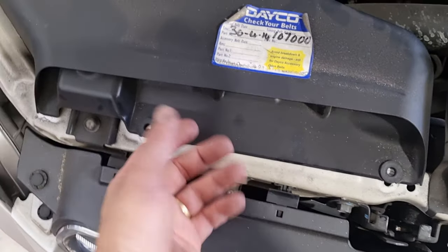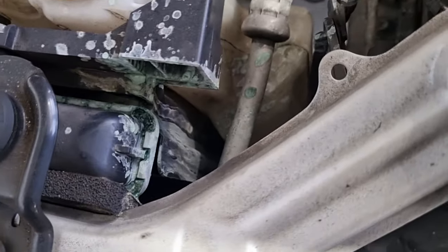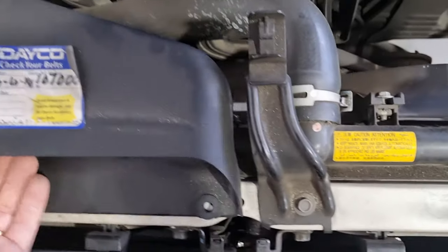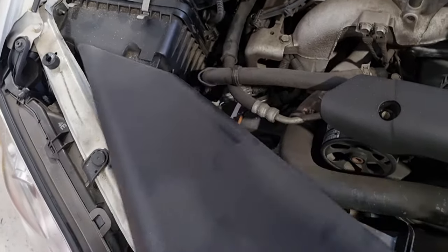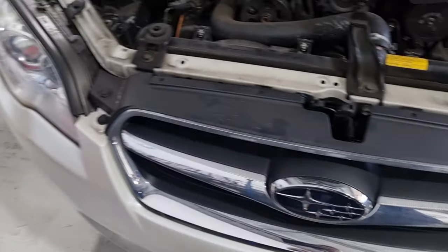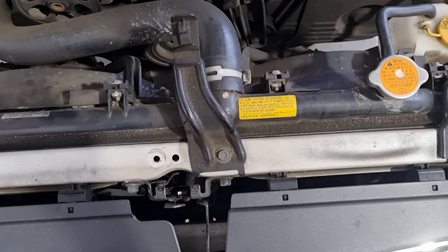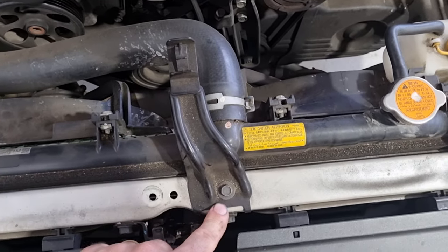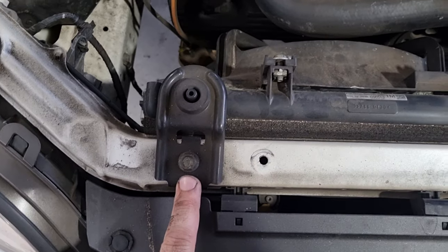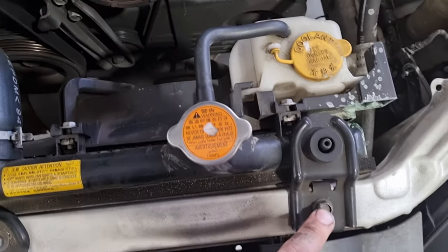First up, I've already ended up taking these trim clips out when I was doing the service, and we can see that the leak is coming from the top tank — pretty common on Subarus. So we can go ahead and take that out. While we've got the roller up the top in the engine bay, you need to take the bonnet support bracket out: 10 mil here, 12 mil here for the radiator mounts, and 12 mil on this side.